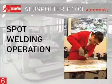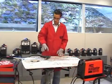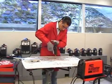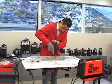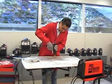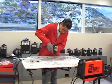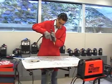Spot welding operation: Gently lean the gun on the working point. Press the button and push slowly until you get the automatic striking of the discharge. Once the weld is done, pull the gun out perpendicularly to the stud. According to the damaged area, fix more M4 studs in order to optimize the pulling operation.